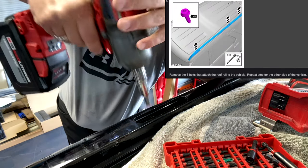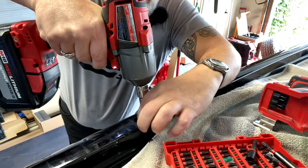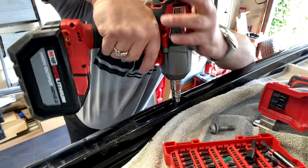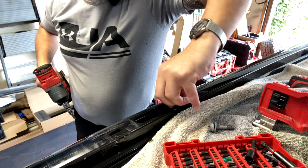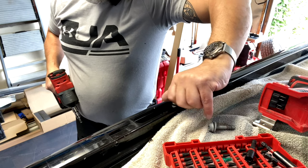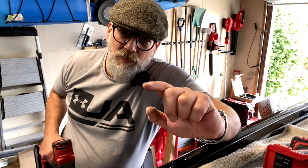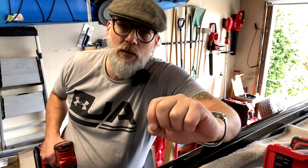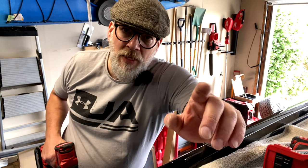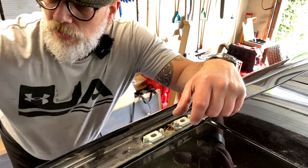So you've got these big sprung clips in the end and you've got to slide something down there. These obviously do something - perhaps they stop it chattering. This is what it says to use so you remove these - this is a T40, T45 - whip these off like that, and then you can throw these because they're apparently too long. I did read of a guy on the Disco 5 forum who created a neat little fishing line affair that went round and you could push down on the device to help you get them out. That's one way of doing it as well.